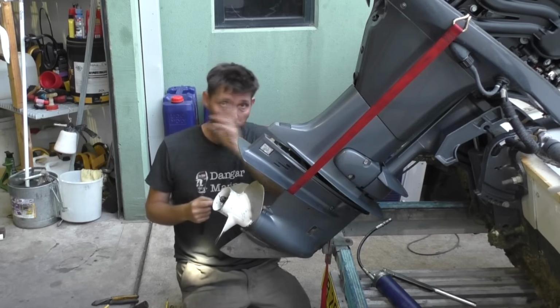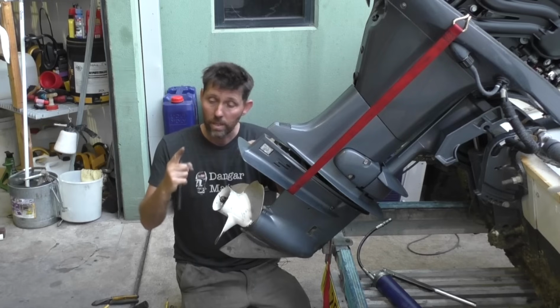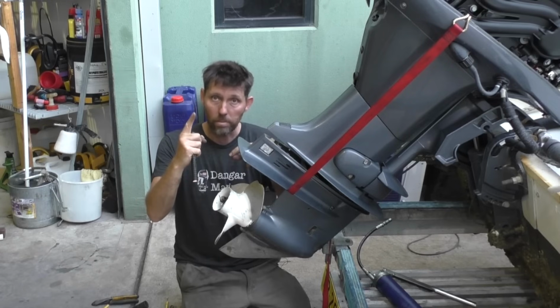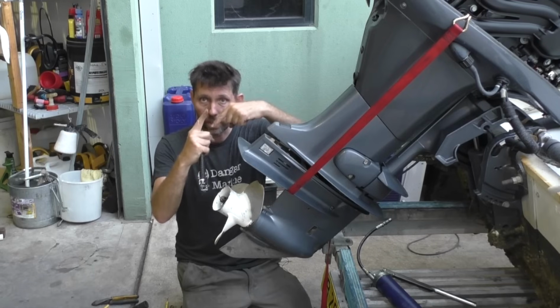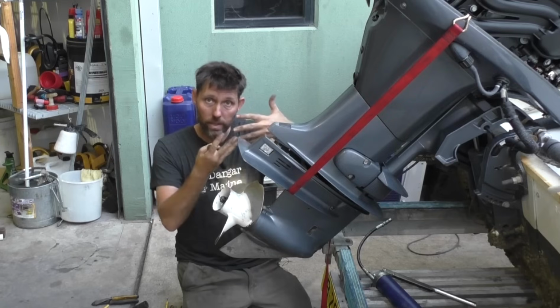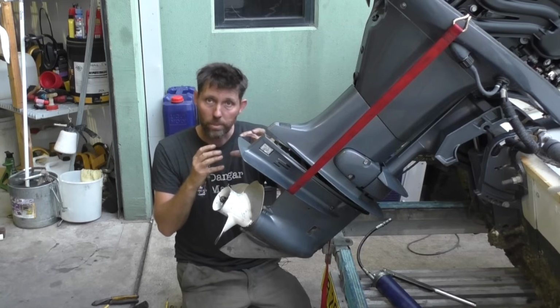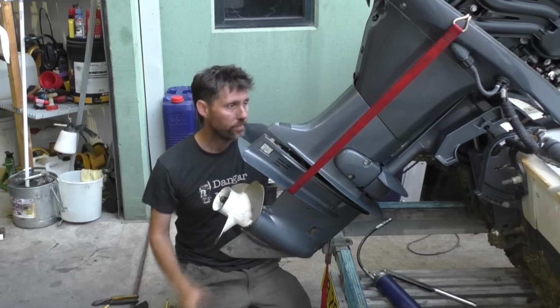Unfortunately, I won't be able to get the camera in to show you because it's quite a small gap. But if I shine the torch in, what I can see is where the spline from the gearbox comes up to the gear selector, they're actually not mated, they're beside each other. So I'm going to have to drop it back down a little bit, now that I know that the drive shaft's aligned, drop it down, focus on getting those lined up, and push it up again.